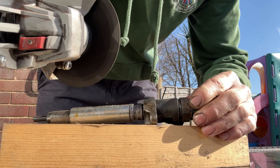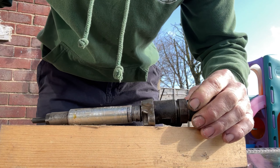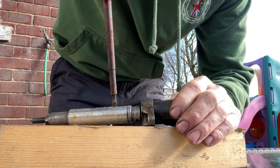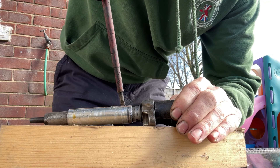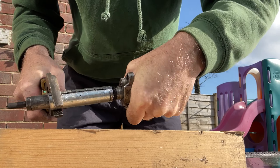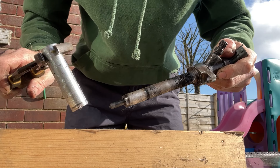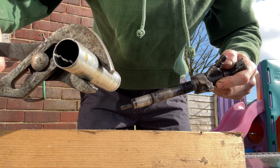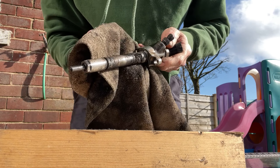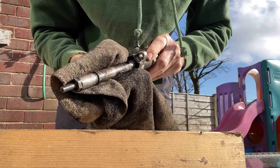So if you ever come across an injector seal that you've pulled out and the injector sleeve is pulled out of it - big problem. I tried heating it up with a heat gun, spray oil, car cleaner, and brake cleaner down the ends. It wasn't working, so I've had to resort to the grinder. You've got to be careful - as you can see I haven't touched the inside - and just prying that has released the pressure. With the grips you're kind of compressing and crushing it.